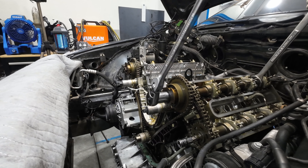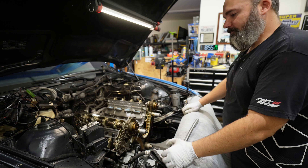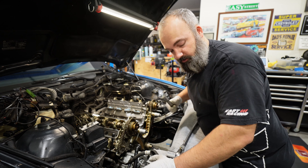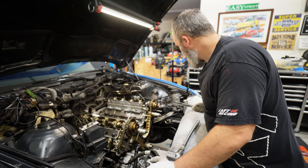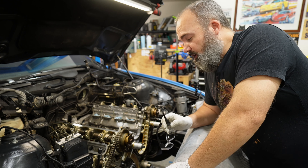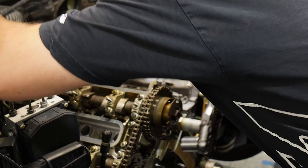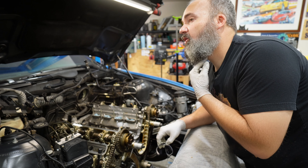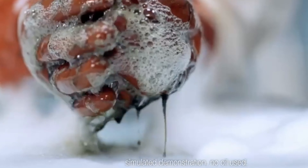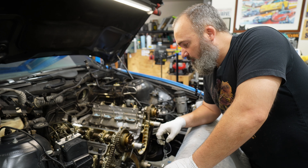Hold your cam — there we go. These guys shouldn't be all that tight. If you move the VANOS gear, oil is going to shoot out of it all over your face and your cameras. I'm going to take five, clean all this off and be right back — I need a drink and a shower. Dawn dish soap does a pretty good job of getting engine oil out of a beard. I think it shot straight up because my whole beard was saturated from the bottom and down my chest, all over my mic.